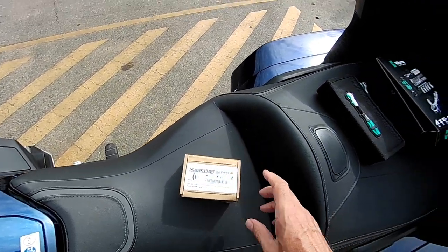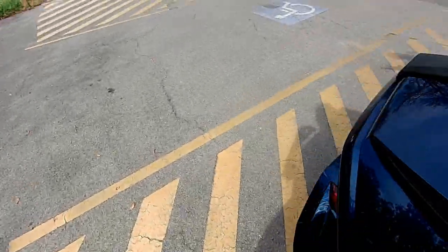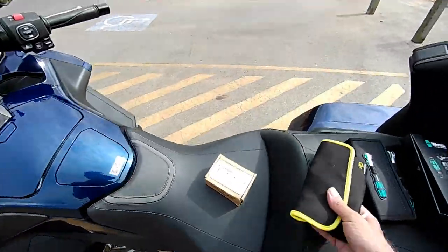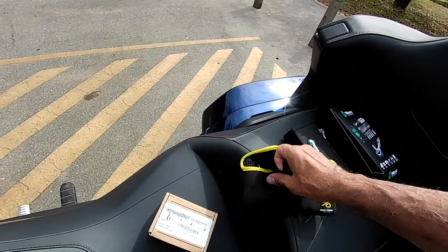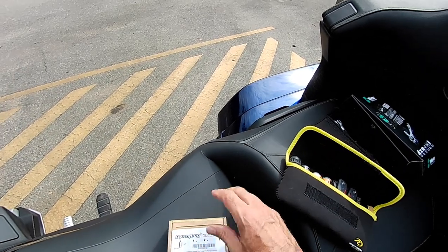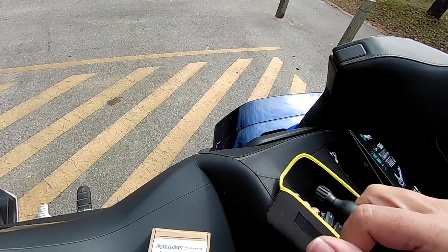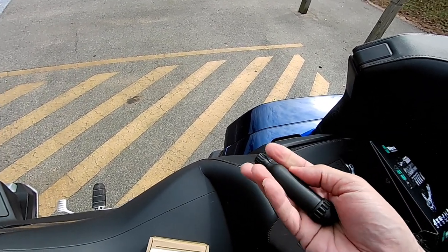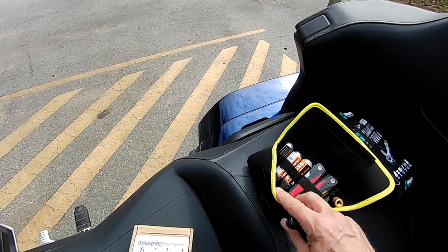There's a variant of the Dynaplug that I think is somewhere in my side bag — that's probably the one I'll keep on the bike. This one is good for both cars and motorbikes, whereas the other is especially for motorbikes. When looking at the Dynaplug range make sure you get the right one. The motorbike-specific variant has a softer head, not made of aluminium, so you get a little less leverage, but on a motorbike tire you don't need it.